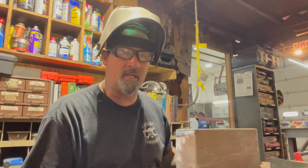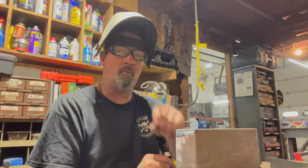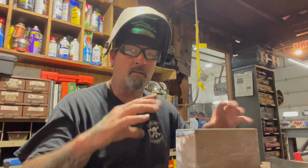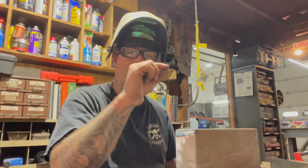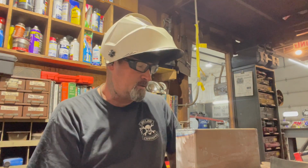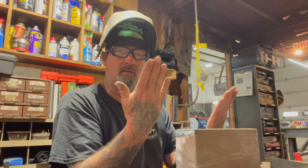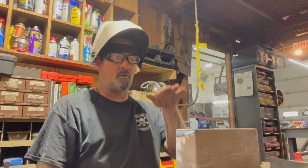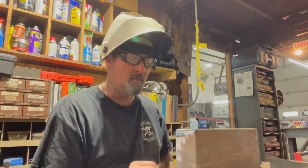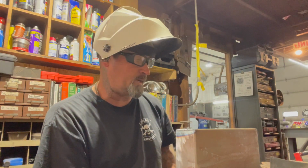I'll clean those up a little bit so that when I sink it inside the tailgate, there's gonna be about a half inch all the way around sticking out, and then I'll be able to angle it however I want, and then I'll use the TIG welder and put a couple tacks, drop to the bottom, run a level on it, and then maybe put just a couple degrees, like 3 degrees or something, so it's sitting in there a little bit kicked, so that when you're at the back of the truck, that license plate isn't straight up and down where you can't see it, it'll be tilted just a little bit. So it should look pretty nice, but I'll film some more when I start doing that.